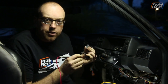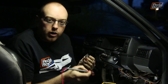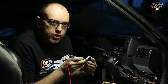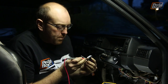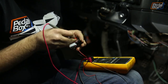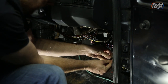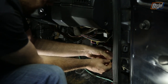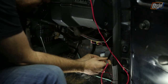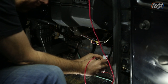Once you've done that, the best thing to do is get the other end of your spool of wire, connect one end of a multimeter up in continuity mode, and check all the way through that everything connects — it should beep. Next we just trim the K-line down, put it in, and do exactly the same again. We can test continuity on the last one. All good.